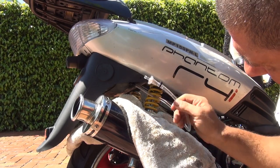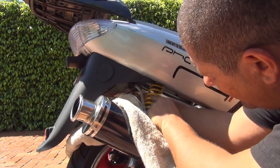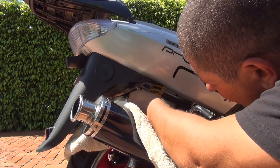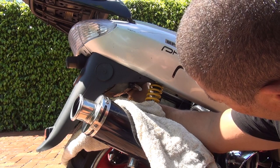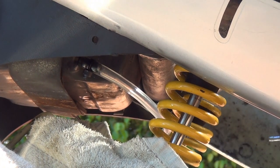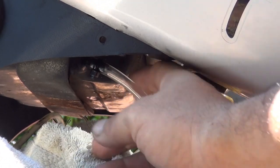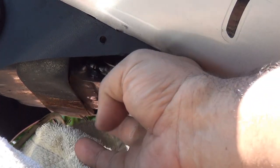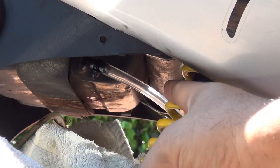Run this line straight from here to the other side. Later you're going to secure this hose a little higher with a zip tie so it connects over there and doesn't bother anything. Make sure the hose is not too close to your shocks — it will get squeezed and damaged. The hose has to be turning away from the shocks, and later we'll put a zip tie up there so it doesn't move too close.